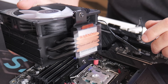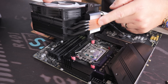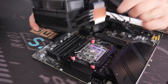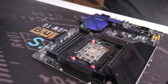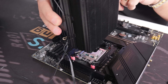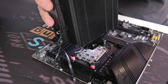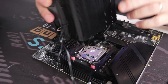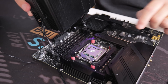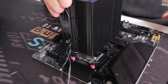Next, remove the plastic protection from the bottom of the CPU cold plate, and if there's any adhesive residue, clean it off with some isopropyl alcohol. For this section, route your fan to whichever side it's going to be on. In this instance, the fan is going to be on my right-hand side, exhausting towards the rear IO section. All you want to do is match up the screws with the two protrusions coming from the bracket — line up whichever side is easier, sit it on top, then lower the other side down into place.